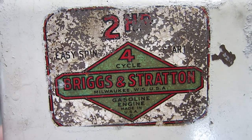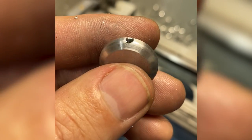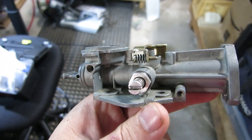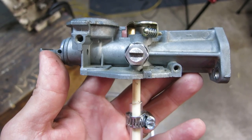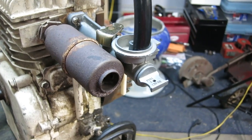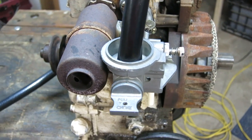Nobody makes a conversion kit for a two horsepower engine made in 1974. I actually made a Venturi carburetor — it ran really rough and at too low of an RPM to use for this project. I bought a carburetor from eBay made for this old engine and connected a gas hose to the spud. It ran okay, but as soon as I tried to throttle the engine, it died every single time. I also placed the gas hose directly into the air filter hole. It ran smoothly, but again, it had trouble revving up. I learned a ton by doing these experiments over the past few weeks and now I think I have discovered a usable solution.